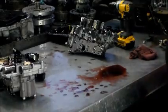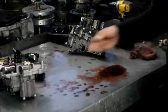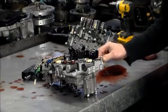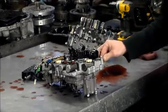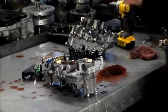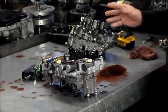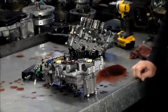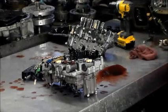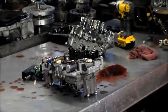I've got to get going on this thing. It's a 2010 Toyota Camry LE, 2.5-liter motor, U760 valve body with code P2716 — that is line pressure control solenoid D, or solenoid D electrical. We're going to change out the SLT solenoid and the internal harness, put it back together, new fluid, filter, pan gasket. We're going to drive this thing and keep our fingers crossed. I'll wait to post this video until we know what's going on with the car. Thanks for watching this video on the Toyota valve body and U760 six-speed trans, and have a great day.